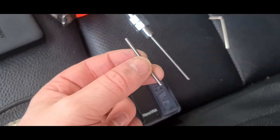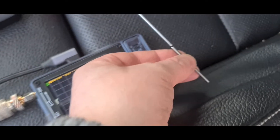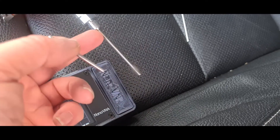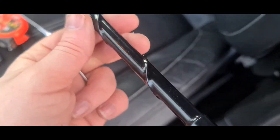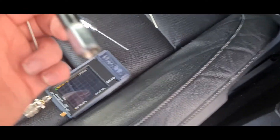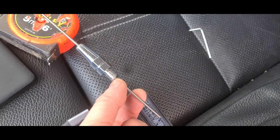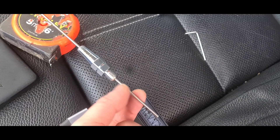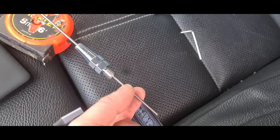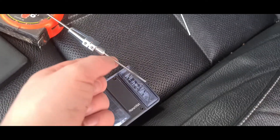As you can see I've sawn a wee bit off — just took this off the end here. If we have too much coming down and going inside it can overheat, and we certainly don't want that. The reason I've not taken it right down to the very threads is because I want a bit of play here. SWR could change and I want a wee bit of leeway where I can lengthen or shorten it, so I'm not just stuck and can't lengthen it anymore.